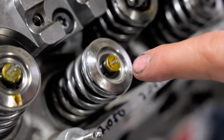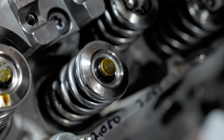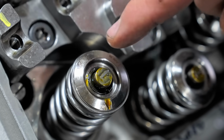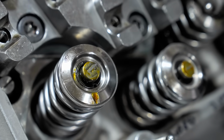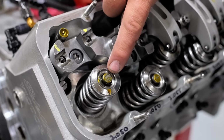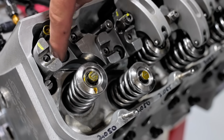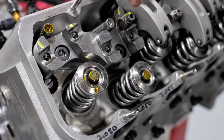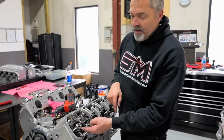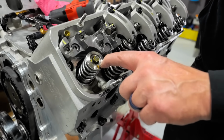You can see, can you see that real good light reflection? Yeah, really good. You see how that is right in the middle, very minimal amount of sweep. This one is maybe not quite as close to the middle, it's upwards a little bit, cannot correct that. No matter what you do in raising or lowering or push rod length, you're not going to be able to correct that because it will get wider if you raise the stand. But then since this is a one-piece stand, it is what it is. You can't separate it. If I raise this, then it makes this one wrong. And that one is 100% acceptable and nice and perfect.